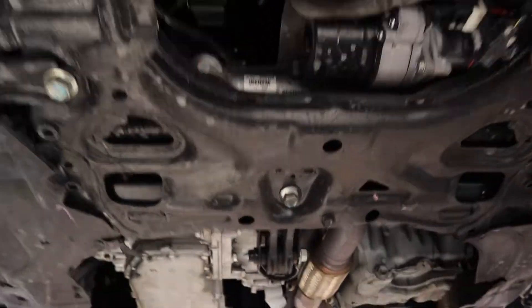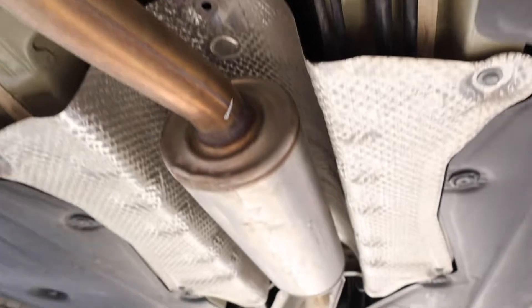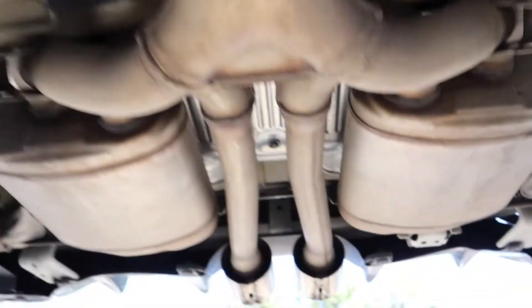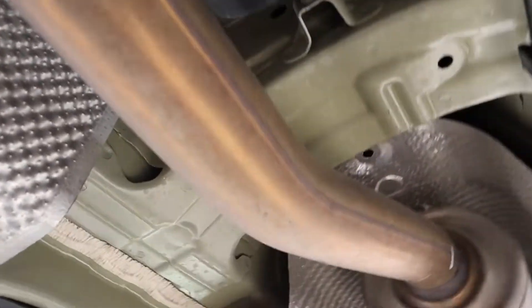The sun keeps hitting me — the lighting is great but Jesus, makes my eyes water. So that was the before. Right now I'm heading to the exhaust shop to cut all this off this brand new car. We got the daily, we got the tips right there. Looking at the undercarriage of the Honda — we're chopping this off and chopping this off. This is the downpipe right here; I want to get a catless one in the future, but for now it's just gonna be the resonator deleted, muffler deleted, and these tips.